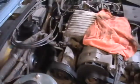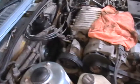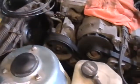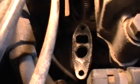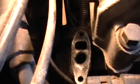Okay, where we're at now is we have removed the EGR valve, and the EGR valve is back here by the back three plugs. There we go. I was able to get the back one with the socket, and then the one that was closest to me I was able to get with a wrench. So what we're doing now is we're cleaning that EGR valve.